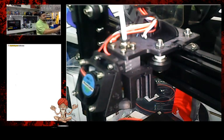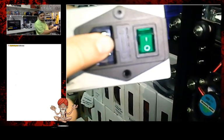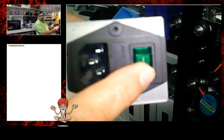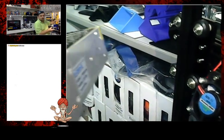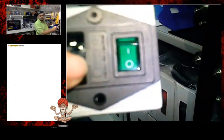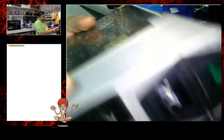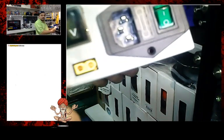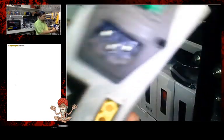Another plus is this — it's not just an outlet plug, it's a switch to turn it on and off, and it has a built-in fuse. So if anything happens in your printer — a wire goes bad, a stepper goes bad, or a wire gets kinked and shorts out — it just blows your fuse instead of something horrible going wrong. And I added one more extra thing: XT60 plugs. That way you can plug it in, plug it out, transport it, make it easy, with no wires hanging or tangling.